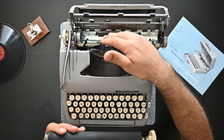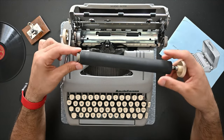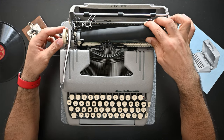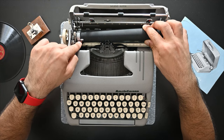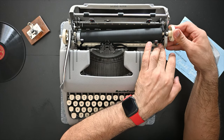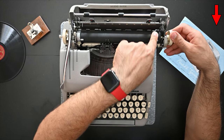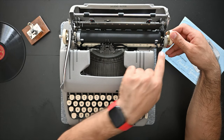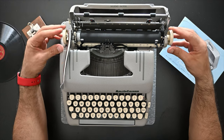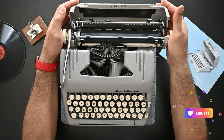This is a nice way to clean inside your carriage and make sure there's no sticky paper or dust on the sides. To insert the roller back, place the left side into the left side of the carriage and push it all the way. Make sure the paper fingers are above the platen — same applies to the paper finger on the right side — and push the roller all the way to the left. Push the lever down to its original position, then push the pin on the left side of the knob, and the platen should move nicely as it was originally. Return the paper bale and close the carriage cover from the back.